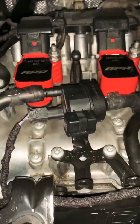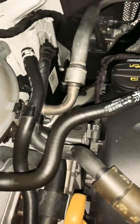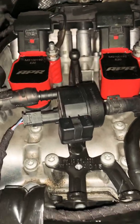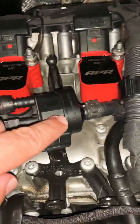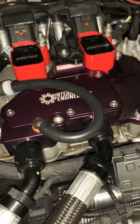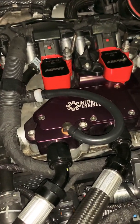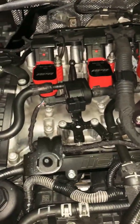that little sucker right there, when he opens and starts pumping vapors that come from the tank, goes in there, that's the inlet, and gets pumped into the engine. And those vapors were messing up everything. My AFRs were crazy all over the place. Car would start to misfire, and high cylinder and EPC, and everything was crazy.